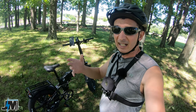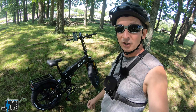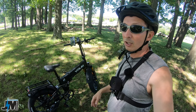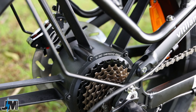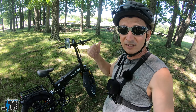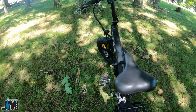I'll see what I can do about getting another coupon code after that. This is a class three e-bike — you can turn the speed down to class two if you want, but check your local laws. This bike has a 48 volt 14.5 amp hour lithium battery powering a 750 watt motor with a 22 amp controller, and they say it peaks at about 1,000 watts. We'll be testing that on a hill climb.